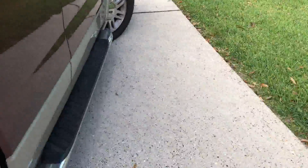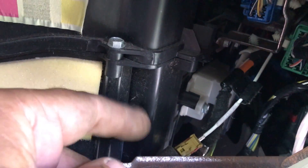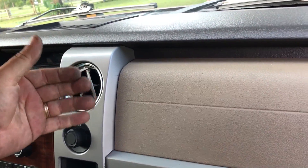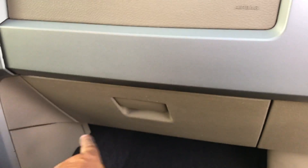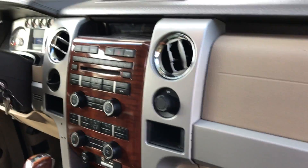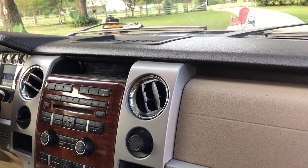Behind this glove box — I've done this so many times — that white thing is a resistor that goes into the fan blower motor, and it goes out so many times that this is my fourth one. There's also the blend door actuators — it's got two of them, one way up under here and one way up over here. The top one opens and closes the blend doors to put air to the passenger side and at the floor. That went out and it's a very common problem. Ford charges about $600 to replace it with the part being about $150.